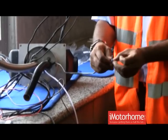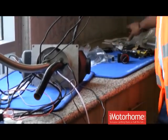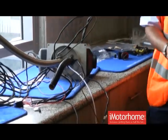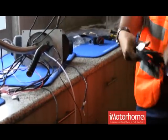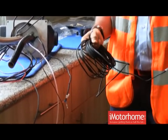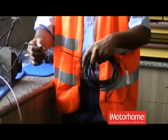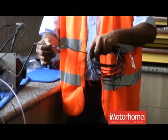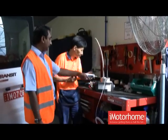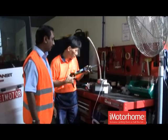There are two black wires that go and connect to the fuel pump harness. The fuel pump harness is supplied in the kit — this is the plug for the new DP40 pump. This side will connect to the two wires here and polarity doesn't matter. It's very important to apply silicone so you don't have any dust or water getting back into the cabin.